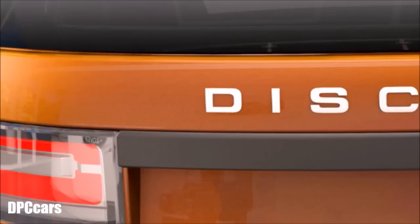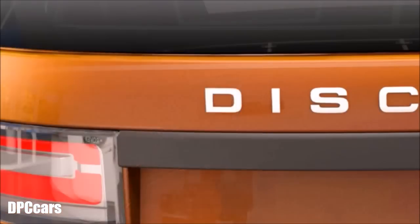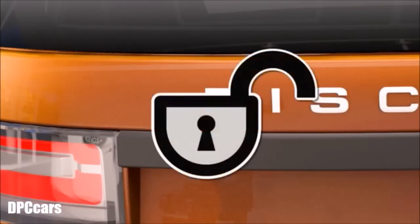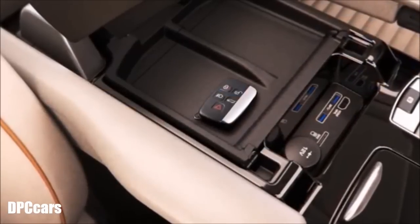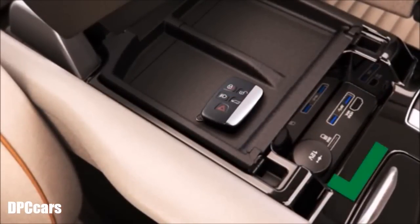When returning to the vehicle, reactivate the antenna by pressing the tailgate release button. The antenna activates for 30 seconds, allowing you time to place the activity key wrist strap against the letter, as shown on screen. When the antenna recognizes the activity key, the vehicle unlocks and disarms the alarm system. The hazard warning lamps flash to confirm. When the vehicle is unlocked with the activity key, any valid smart key inside the vehicle is re-enabled.